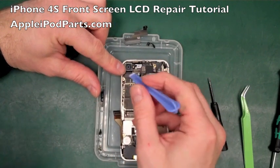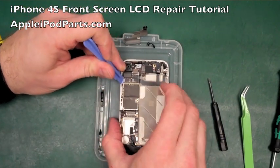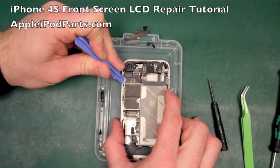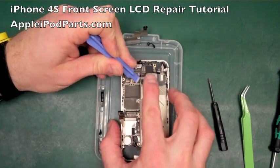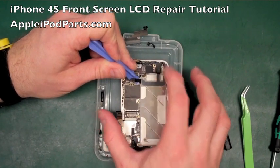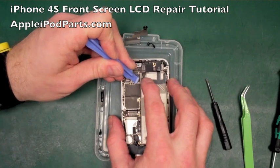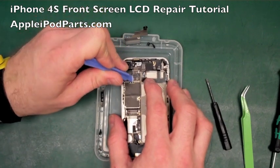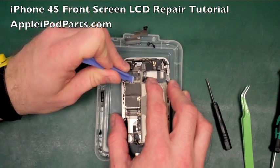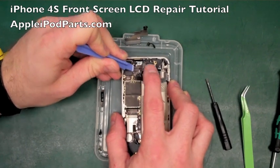The little circular aerial connector coming in here, and we start undoing the connections for all the cables, the ancillaries connections. You've got one there that lifts up. That goes around to the volume and I think the mute, possibly the headphone jack. A little connection underneath here. You have all sorts of sensors and stuff running along there, and then there's one connection there as well. That should lift off. There we go. That's all the cables unplugged.